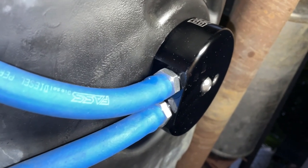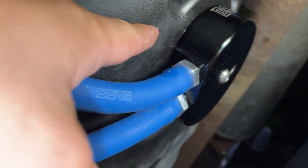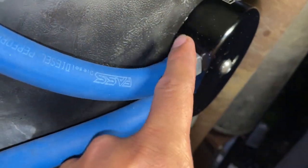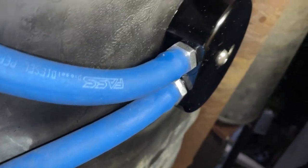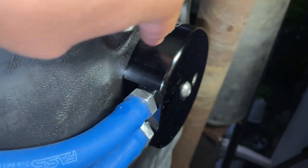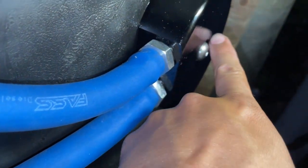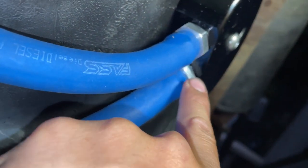My phone died so I did a lot of this off camera. Going back to putting that aluminum plate in there — I pushed the basket off to the side a little bit, and from the opposite side brought that aluminum piece in to lay it down and slid it under the basket. After that I was able to get everything together, tying it down. The sump is torqued down to 22 foot-pounds, and these fittings are torqued down to 25 foot-pounds.